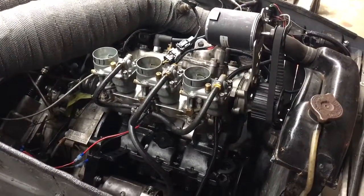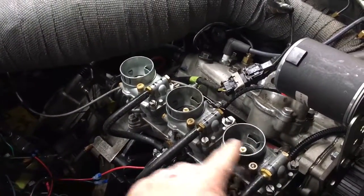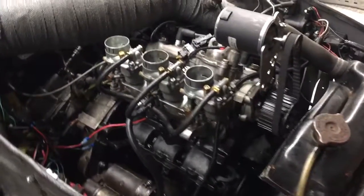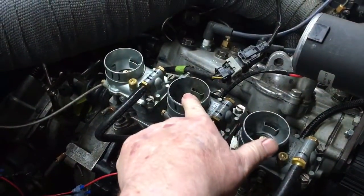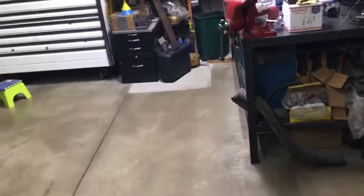I did run a test with a 20-point difference — I put a 165 in here with 145s on the outers — and I was too rich in the center. So I think a 15-point raise in your jet size is the answer. So if you're running a 120 on the outers, you should be running a 135 in the center.